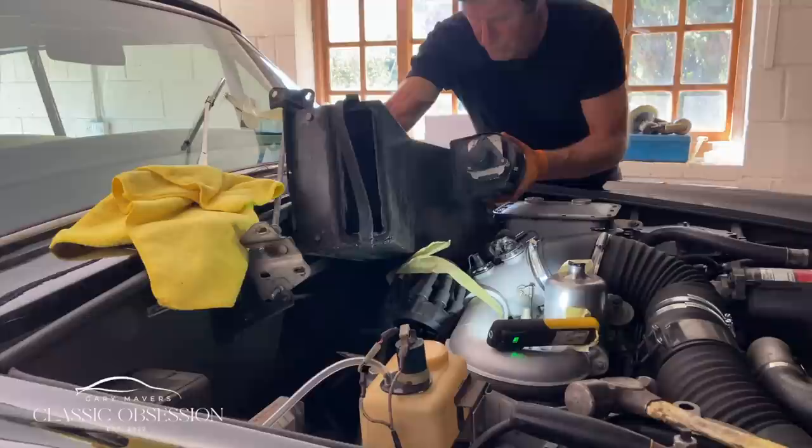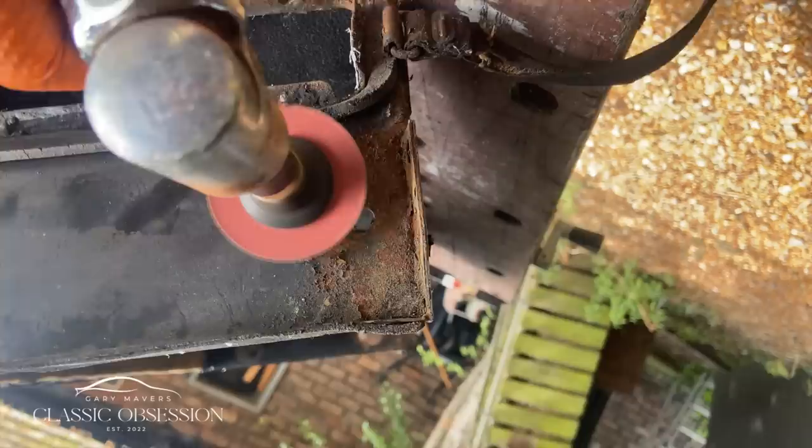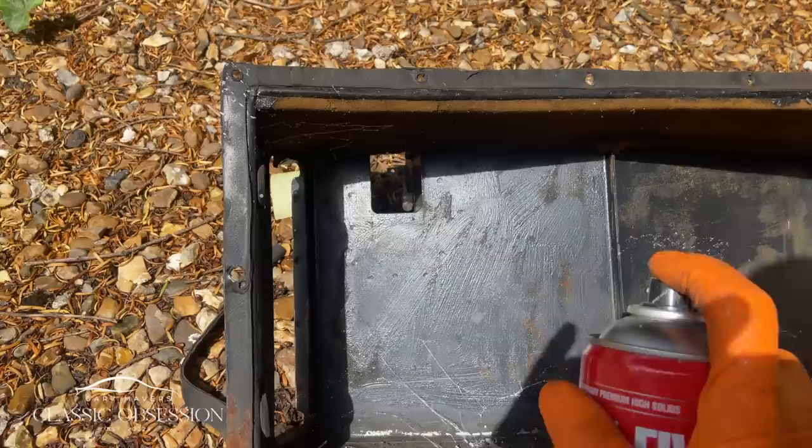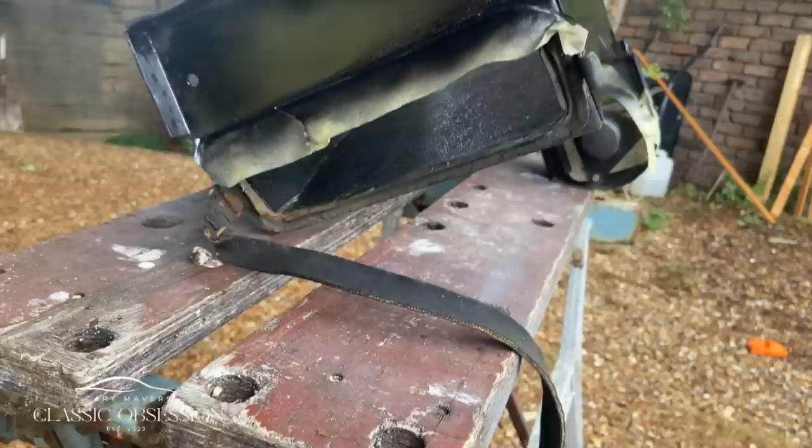So since last time I've been getting stuck into another couple of jobs. First I had to replace my heater matrix, which had just decided to start leaking over the passenger footwell. Although the matrix itself is nicely accessible, situated in the engine bay, this is by no way an easy task. As hampered by space, you've literally got to be a contortionist to navigate the heater control rods through the heater box without damaging them — another job which was probably done at the factory before the engine was fitted to the car.